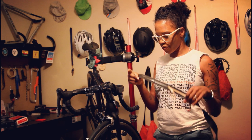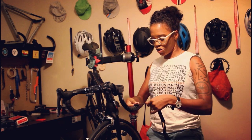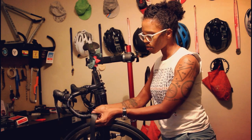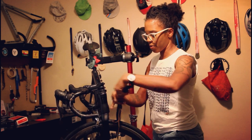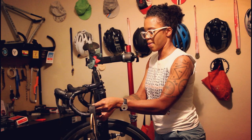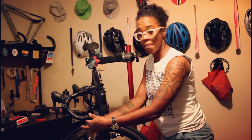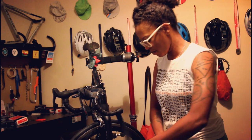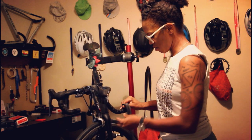The first step is to leave a little bit extra so the tape can be pushed in for the bar end plug. You're going to go from the inside, out, and toward the inside of the bike in a diagonal circular pattern. This tape has a self-adhesive backing, so I'll move that out of the way and start my diagonal circles.